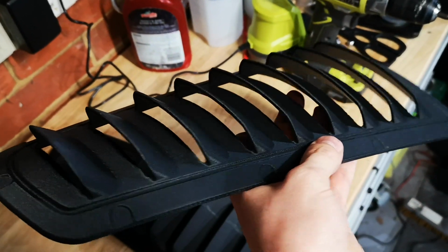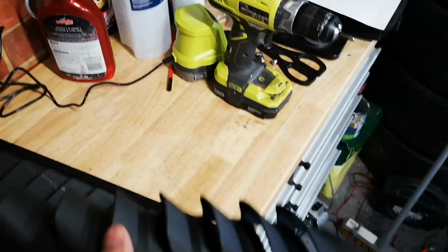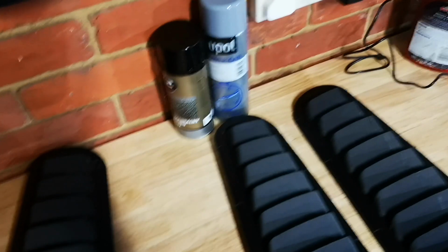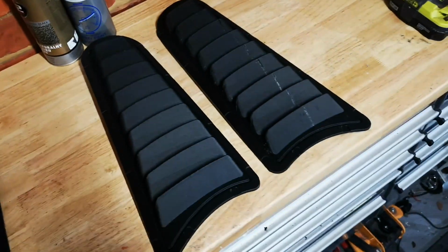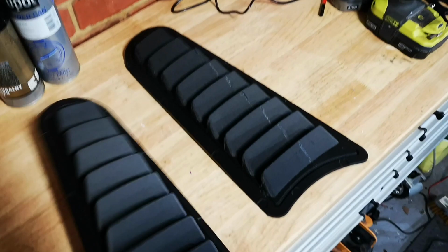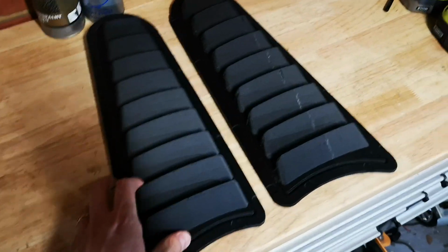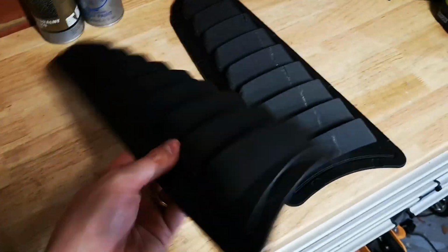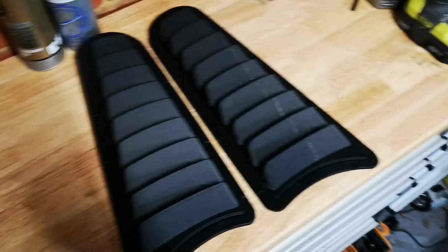The surface quality, I mean, it's okay. As I say, it's a prototype piece, and this particular process is FDM, so in 3D printing terms, it squirts filament through a hot nozzle and builds it up in layers from the bottom up. There's a couple of different processes, but that's the one being used for this because it's quick, cheap and slightly dirty, ready for quick functional prototypes. The final ones are going to be done in a different 3D print process, which will give a much better finish throughout, and you won't have any steps or anything because it will be made up slightly differently, which will be cool.